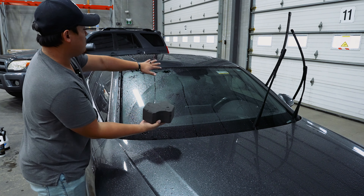Here's another drying tip. While you're actually drying off Absolute from your car, you can actually use a spray sealant or a quick detailer as your drying aid, even while Absolute is on the panel. In my case, my car is coated, so I don't think I need any toppers right now. But if you want, you can use a drying aid like Beadmaker or Stoner's Invisible Glass Glatt, which we all have at tocsupplies.ca.